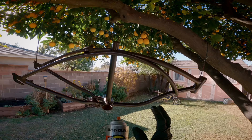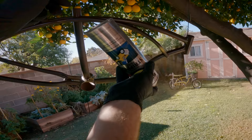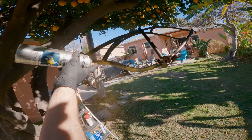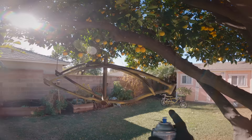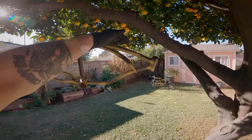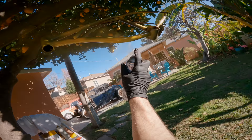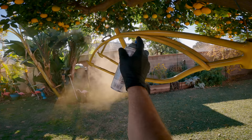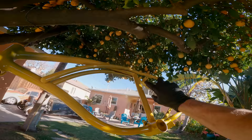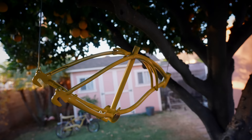Once again I let the paint dry about 20 minutes. First we're going to put on some inverted yellow striping paint, which is really close to what the Bad News was painted by my dad. You have to hold it upside down. I'm putting it on thicker in areas on purpose so it's not as smooth. Now I'm going to use another Duplicolor color that's pretty similar to the car. We're starting to see the primer showing through — I'm going to leave it like that. On the bottom we'll get it pretty solid because the weather wouldn't have hit that area. Let's get a pretty solid base, then clear the can out.